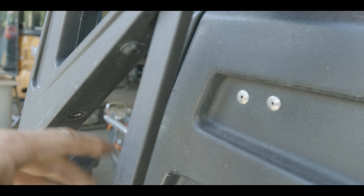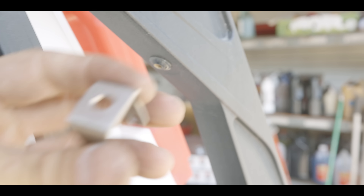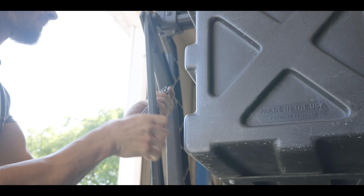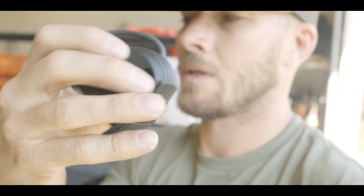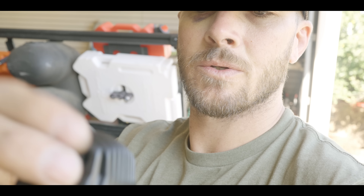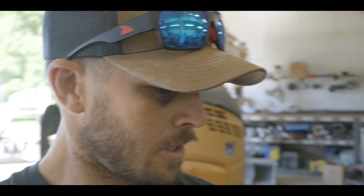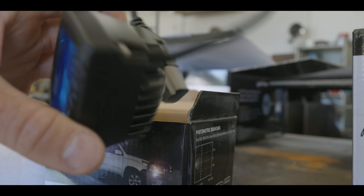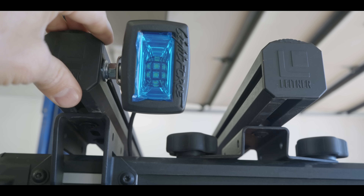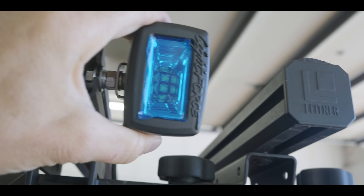These are Rock 20s. We're going to mount those right here on the Leitner rack. I'm going to pull this bolt off — this is the bracket that the Rock 20 comes with, and that bracket gets bolted there so the light is kind of protected in this housing. The Rock 20's fins are in the back; the hole is what that bracket goes through, with the nut captured on this side. So we've got bolt, washer, lock washer, nut — nice and solid.